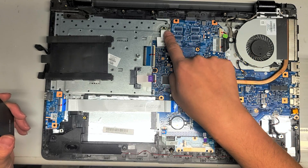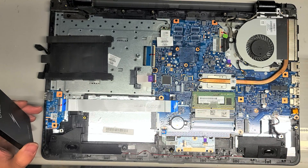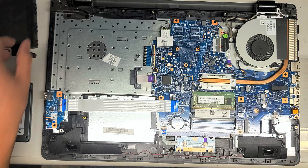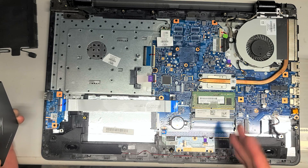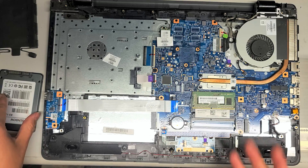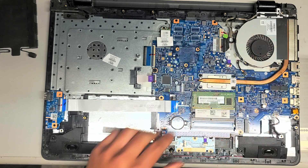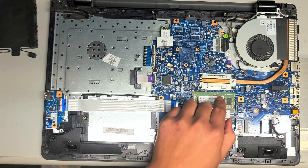There's also the wireless card here — it only has one antenna. That's actually how it's designed; it's probably just 2.4 gigahertz rather than dual band with 2.4 and 5 gigahertz. Certain models will have a dedicated graphics card but this one doesn't. The CPU is soldered to the board so you can't replace or upgrade it. Hopefully this video helped you see what's inside the computer and how you can upgrade it — please like and subscribe to help others find these videos. Thanks for watching!